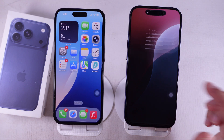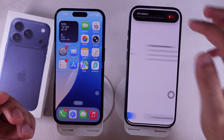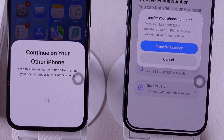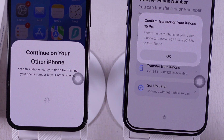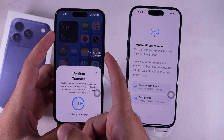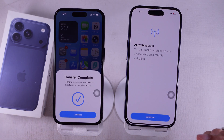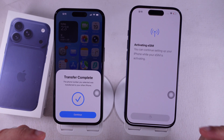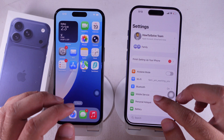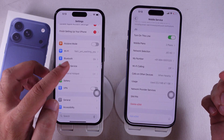After reboot, you'll see an option to transfer your eSIM. Tap Continue on the Restore Complete screen. Your iPhone will ask to transfer your phone number — unlock your old phone and tap Continue. Select Transfer from iPhone, verify the number, then double-press the side button on your old iPhone to confirm. Your carrier will send a notification for the eSIM transfer. Wait a bit and you'll see an activating SIM screen. Once it finishes, go to the Settings app, scroll to Mobile Service, and you'll see your eSIM is now on the new iPhone. Your old phone will show it's been transferred to your iPhone 17 Pro.